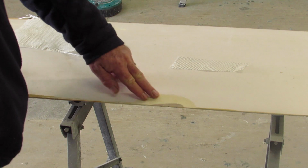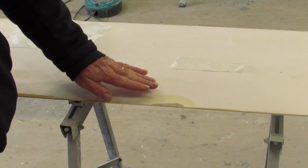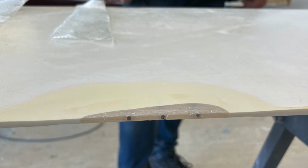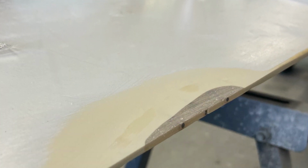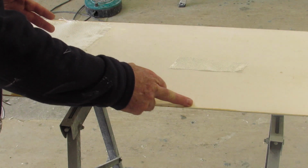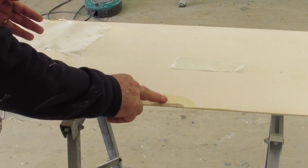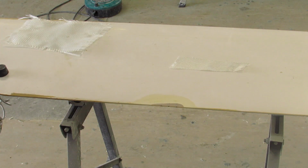So this is after we have done some more sanding on here to get this all nice and even, and we've actually now done the projection along here, so this is completely straight and flush, so we're ready to go. So I said we're going to actually glass fibre across right onto this area here. You obviously can't see it, but if I run my finger across, you can feel a real dip down from there. What we're going to use?